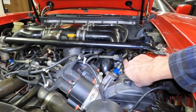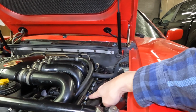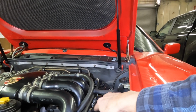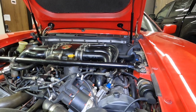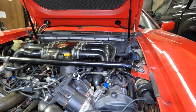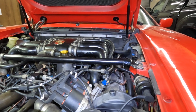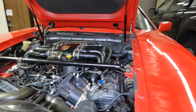And then you can keep this clamp loose. The other clamps I would tighten. And that's the other thing. Since it's rubber hoses, I don't know how tight to keep it. And so when I did a pressure check, there were other leaks. I fixed those leaks, and then basically went to each clamp to see if anything was leaking.